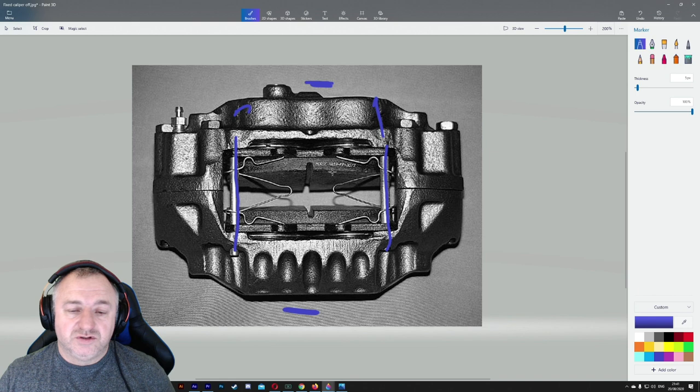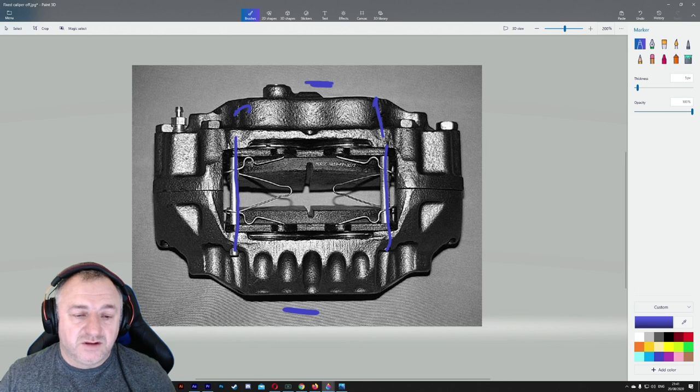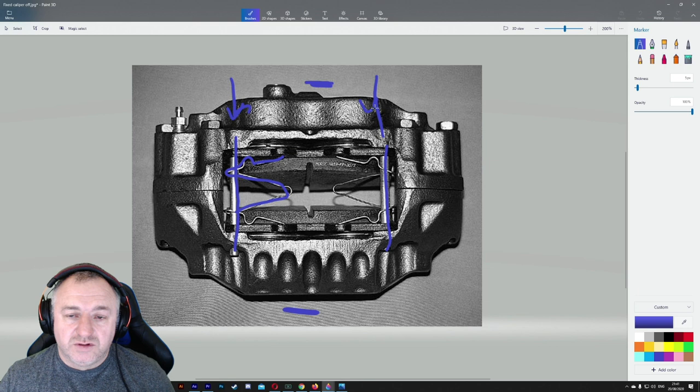And then what you do is you remove the pads, push the calipers back with the normal type of pressing, the windback tool, and then fit the new pads. And don't forget to fit these anti-rattle springs. Once you push the pins back in from that direction, you take the punch and give it a good knock until they stick out like this. You'll know they won't go any further. Knock them till they're out and they should be there.